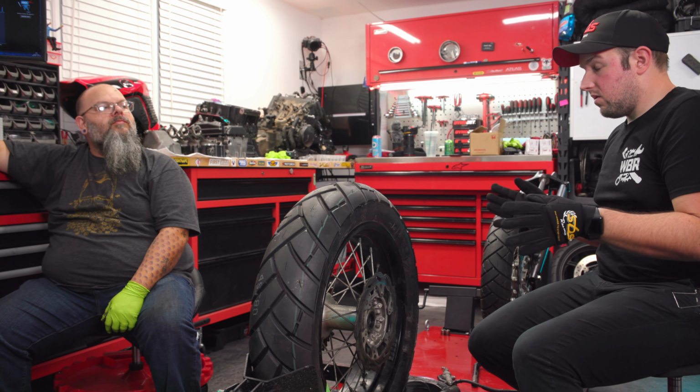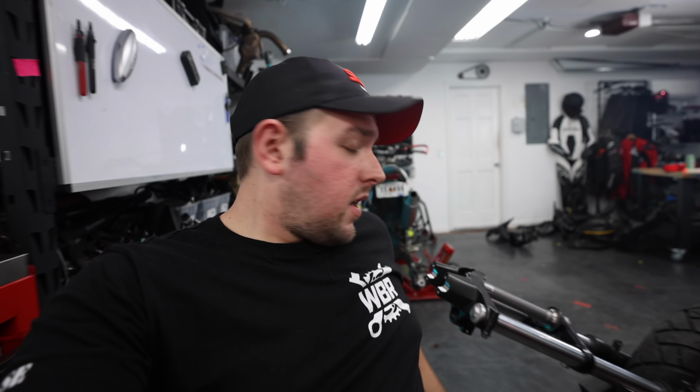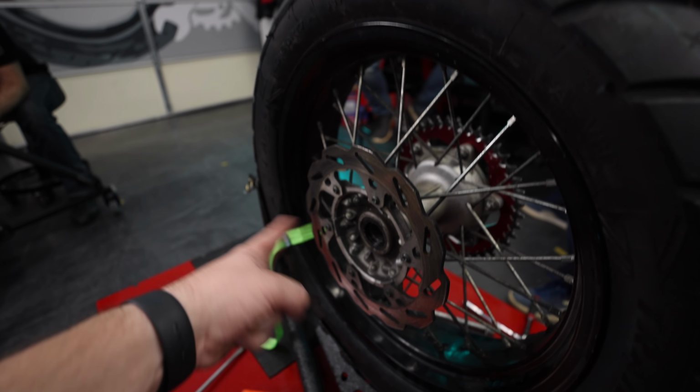Okay, so we're headed to Judd's now. We're going to take all this stuff. Ladies and gentlemen, boys and girls, everything looks good. Swing arm fits over my WR rear and the rotor seems, what is it, 5/8 or 3/8? Too wide. Not too wide, too much diameter. It's too big in diameter this way, and is rubbing on our brake caliper stay. Either we'll have to have Judd modify the rotor or modify the stay or modify both. That'll be up to him, which will be the best way to do it.